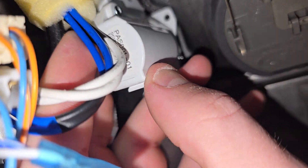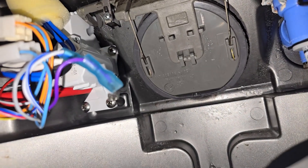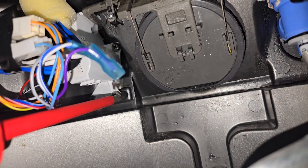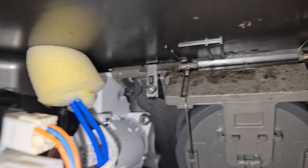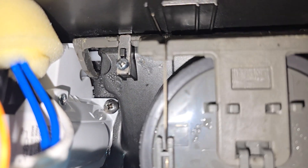Basically the machine's been running, the ice maker box just fills up and gets blocked, causing customer issues because they can't use it or get any ice. So when we've replaced this motor we should be good to go. On the motor we can see the little gear with the little arm that activates and opens the ice maker. Make sure that's above the plastic arm of the ice maker — as that gear rotates and comes down the ice maker flap opens. The little white arm will pull the plastic arm down, and that's what forces the ice maker to open.